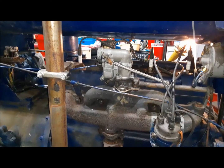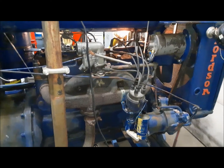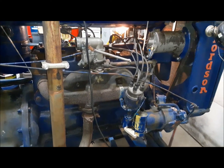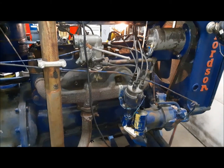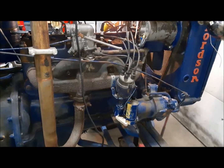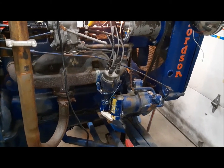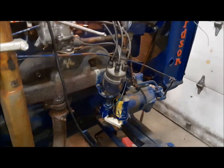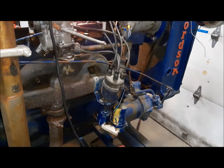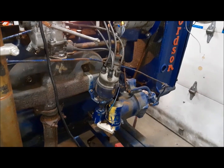It's time to see if I can crank this thing up. I did manage to get it to cough and sputter to life, but it doesn't run very well and it won't stay running. The battery was getting kind of low so I put it on charge. I opened up the distributor and checked the points and everything in there — it all looks good. I made sure it's a distributor that turns the right way, because this is a cobbled-up thing and it could be retarding instead of advancing. But no, it advances — we're good there. I think I'll have another go at it tomorrow.